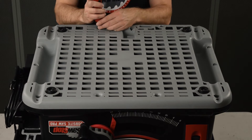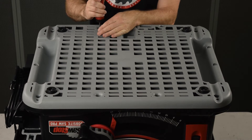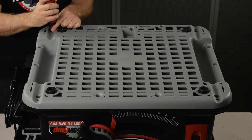Remove the 15 Phillips screws that attach the cabinet base to the cabinet. Use a magnetized screwdriver or magnet to lift the screws out. Start with a screw that's just to the left of the indentation for the counterbalance spring, then remove each screw working around the base counter-clockwise.